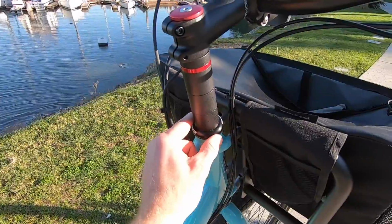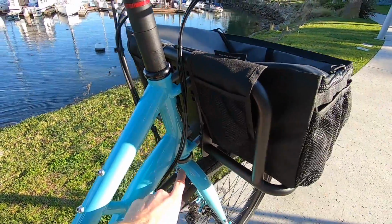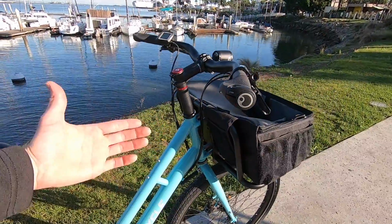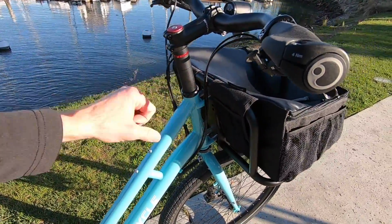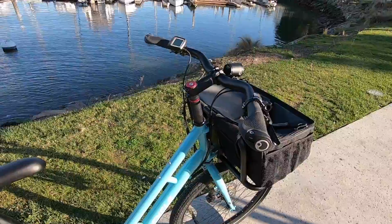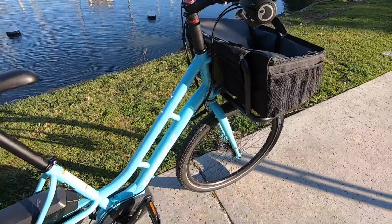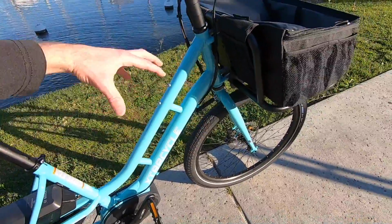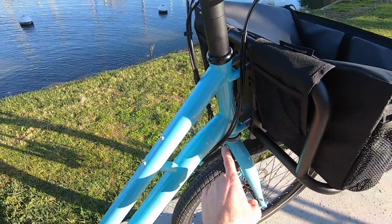FSA, it's like an external cup. I don't think it's sealed. It's a straight headset right there, versus like a tapered mountain biking setup or something like this. So just a little bit different, and that comes back to the steel frame and stuff. And I think they're using like the standard gauge all the way down. It's not really being hydroformed, it's just being bent.